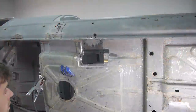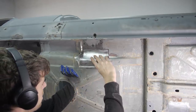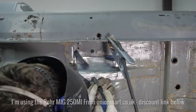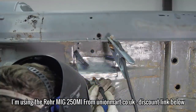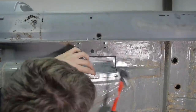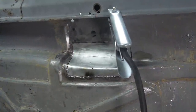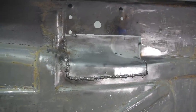Let's continue where we left off. With the new piece ready to go, I used magnets to hold it in place while I tacked it where I could. This piece didn't fit well at all, but I thought if I can just weld it in place where it's flush, I could then whack it into the correct shape whilst it's in the car. After a bit of welding it was finally looking alright. It still needed some shaping, but I was just glad it was in.